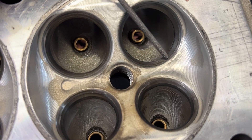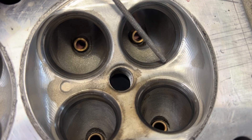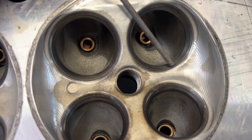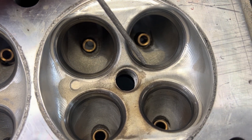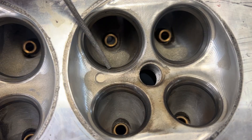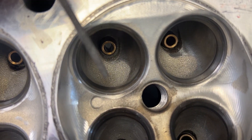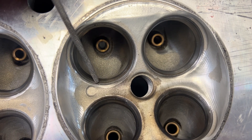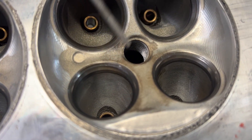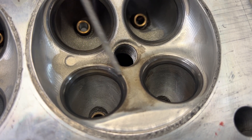The valve job looks pretty decent, a little beat up here. I think we're going to see some valve float because it does appear — it looks okay, but I can see there's some transfer of metal here. That's usually an indication that there is some valve float if you see shadows and stuff like that. The valve is not really contacting it squarely on the intake and exhaust, and you'll notice there's some discoloration between the two cylinders or the two halves.